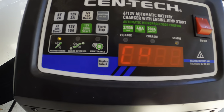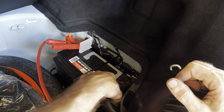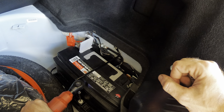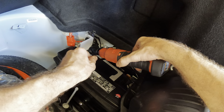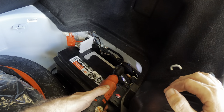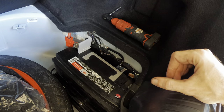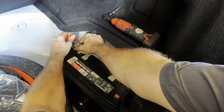Let's select 40 amps and just get the ball rolling here, because ain't nobody got time for that reconditioning — that's a bad sign. This thing is taking way too long to do anything, so I'm just going to toss in a known good battery so I can at least see if I have a battery problem, a charging system problem, or some other kind of problem. I need to know fast because I'm about to go home.